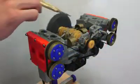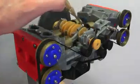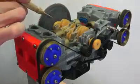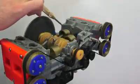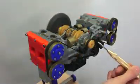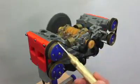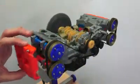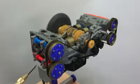Now, running through the different components here, you can see the pistons in gold. Those are connected to, of course, the connecting rods, which are in gray. That is then rotating this crankshaft, which we have in yellow, which will ultimately be sending power to the transmission through the flywheel, which we have here in dark gray. Now you can see the intake valves there opening, they're in blue, and then the exhaust valves opening down there, those are red. On the front here, we have the timing for the camshaft. So you've got the crank here with the timing, and you've got a timing belt here, which is connected to these. And then you can take off this valve cover here and see in blue we have our intake cam, and then the exhaust cam here in red.